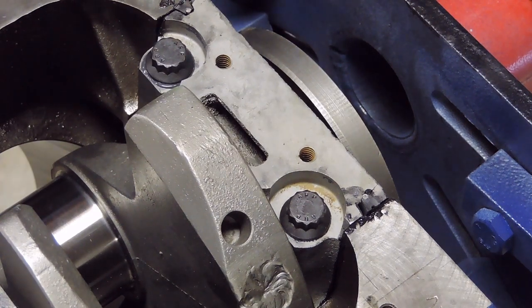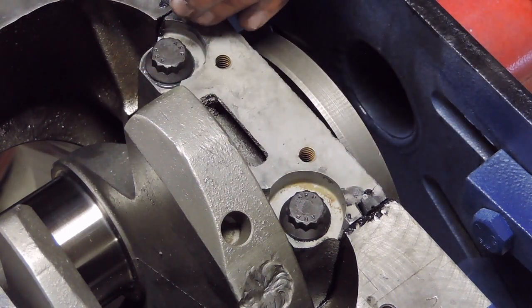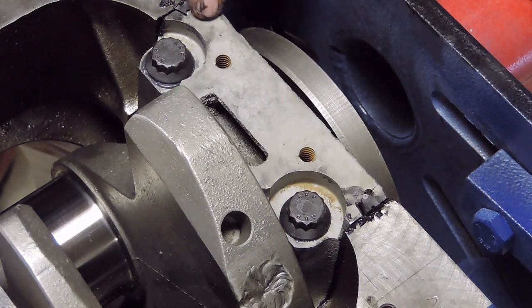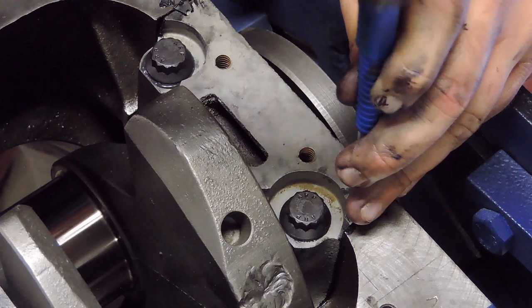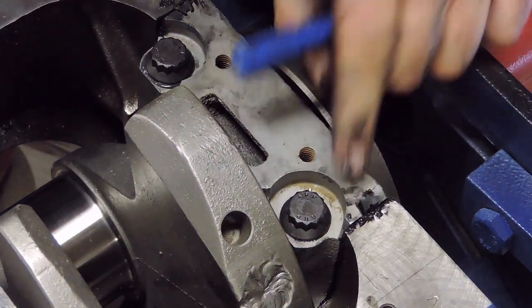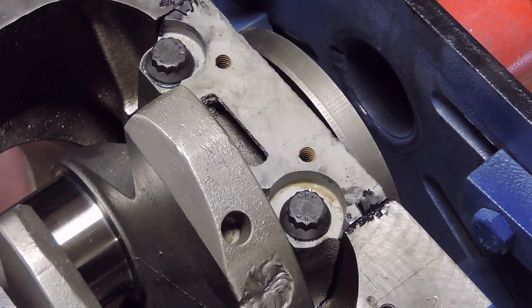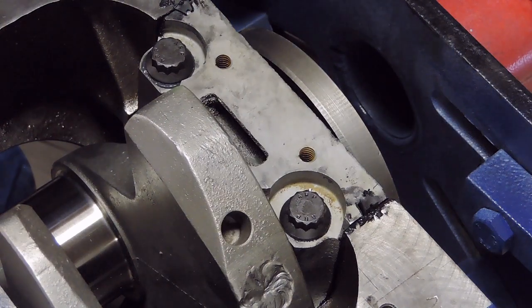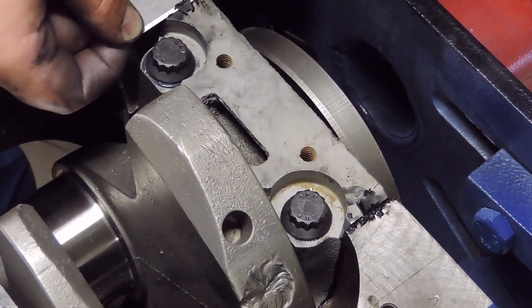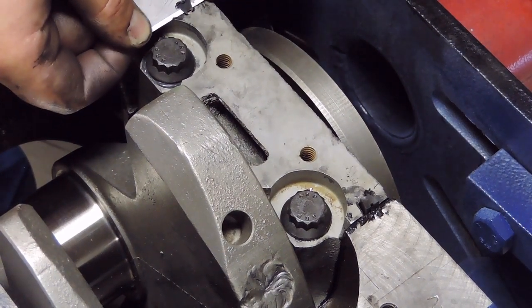So, I have a nail punch that I'm going to use here. Very simple tool, and you're going to want to take this and recess that nail just below flush with this cap. Same thing, just below flush. That way it's just below this cap. And you're going to want a box cutter blade. In this case, I'm just going to remove the blade out of this knife. What you're going to want to do is go flush with the block and just trim off that slight excess there. And there shouldn't be very much.